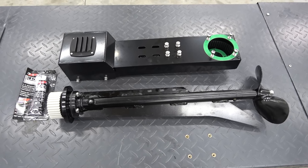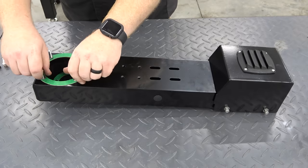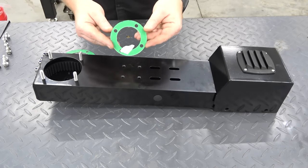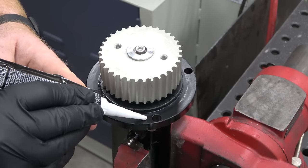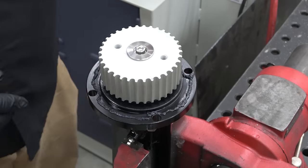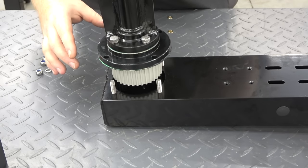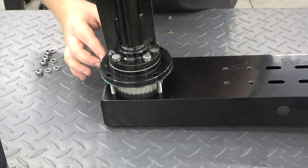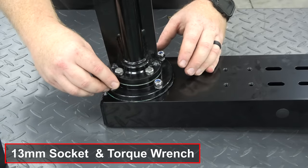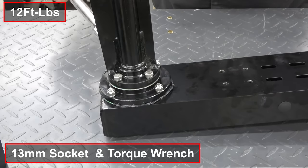Next, I'll be preparing the drive housing and the tail assembly. Remove the nuts on the lower studs and the four bolts in the midsection of the housing, then remove the clutch cover bolts. Use the included silicone on the flange of the tail assembly and smooth it down. Place on the gasket and do a top layer of silicone before mounting the tail shaft to the drive housing.